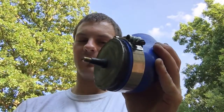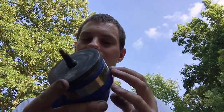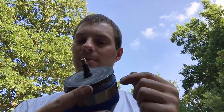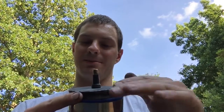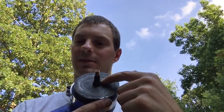In this video, I want to show you how to do a boost leak test. The tool that you need is what we call a boost leak tester. You can buy something similar online, but this is something that I made. I have a 3-inch tester — I got a 3-inch exhaust pipe welded to something flat, a piece of metal, and then I drilled a hole smaller than this tire valve and pulled that through.